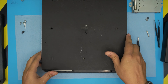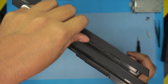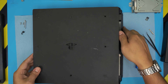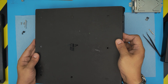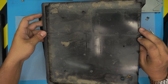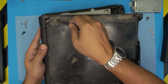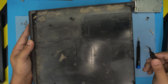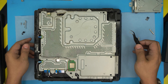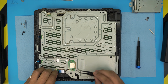Now we're going to do the same thing — scoop from the back end on the sides and corners. I got one side out. Work your way to the corner by the hard drive bay; it's a bit hard. Work through the middle and release the tiny clips the same way we removed them, but this time from back towards front. Lift and wiggle it around to release it. And this one looks like a water spot — there's a big dust pile and a water spot right here, so we definitely have a water situation.